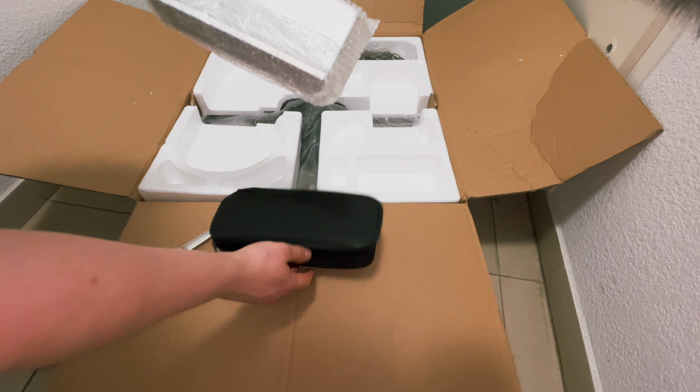Step number 5. Connect your controller, LCD screen, motor and battery all together. The controller is the brain of your e-bike. It is very important to respect the instructions and connect the correct cables in the correct order. Usually Chinese controllers are all the same style. In case you will not have the instruction, I will put a photo of my own cabling so it will help you to connect things properly.